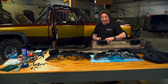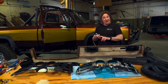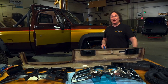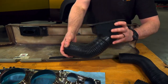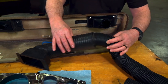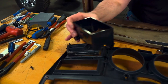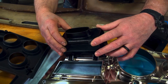Speaking of the vents and trim, these are areas where a project can slow down on you a little bit, because any time you add a bunch of aftermarket upgrade parts like a different steering column, wiring harness, air conditioning — that kind of stuff — it takes some time to make them all work together right, as opposed to just bolting on a bunch of original parts like you would in a level one or two restoration project. Your level threes, level fours, and level fives take a little bit more time. This is the stock ducting for the heat and air conditioning on a square bodied Chevy — notice the size of the hose here. Well, this is the size of hose that Vintage Air uses — not going to work. So they've got special adapters that need to be put on, and they also have an adapter that goes on the original panel here and some adapters on the original bezel. You put your new roller in there, put that on, and then the adapter pops on like this. Then you're ready for Vintage Air hoses.